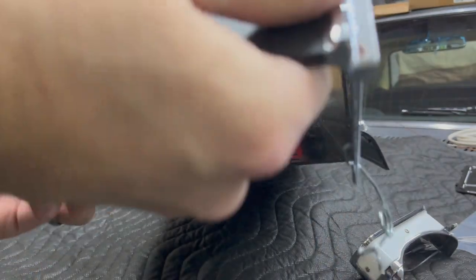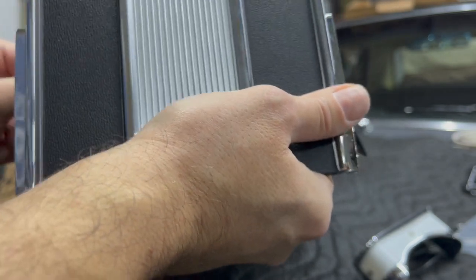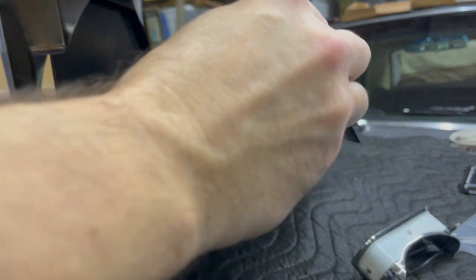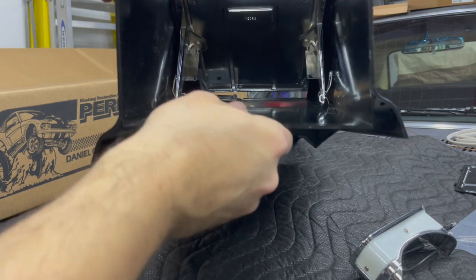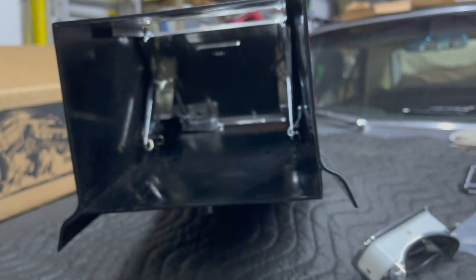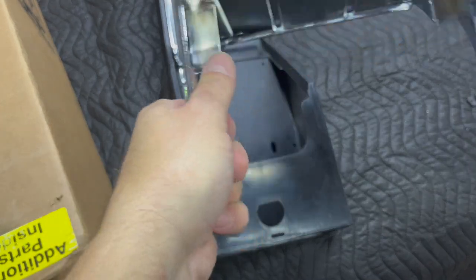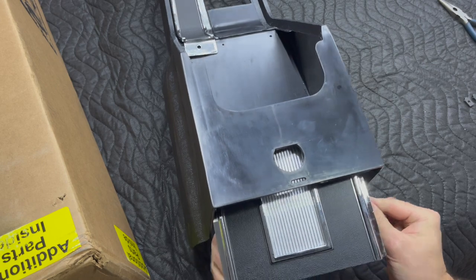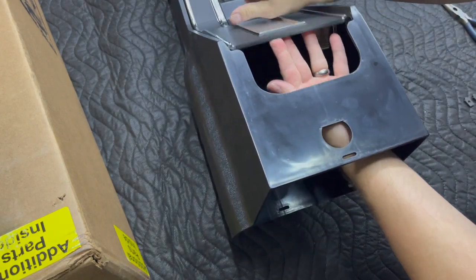When you put the door in from the back you do need to push the springs forward — kind of lay them in, let them go in first, and kind of shove them through. You'll see why in a minute as we reposition the springs after you get the door in. It's a little tricky. It's best to stand the console up on its end if you can, or at least lift it up — gravity will help the springs go forward. Here's another view of the same procedure: pushing the springs forward and then slipping the door in through that large opening at the back. It really goes in quite easily and correctly this way.